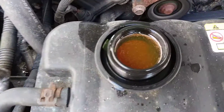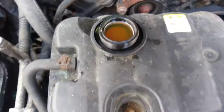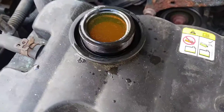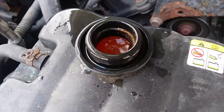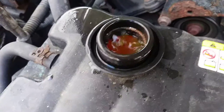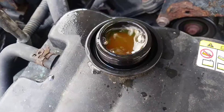You can see the coolant reservoir is right on top. All you gotta do next is squeeze the upper radiator hose a few times after it's warm, and that way it will get the air bubbles out of your cooling system, and you will soon have hot air coming through.